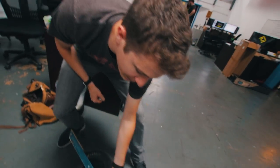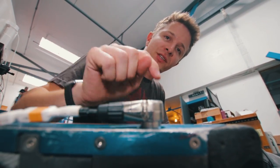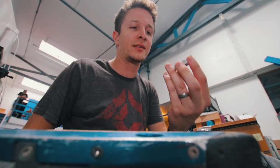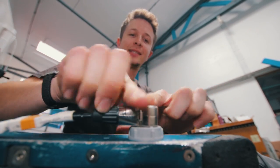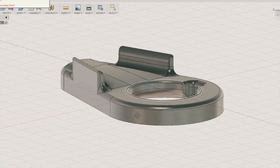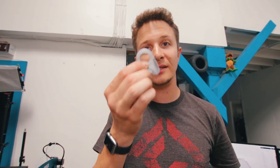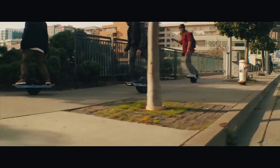Here is the finished plug — I've got a quick-release port so when I fall off it just unplugs and doesn't do any damage or get tangled up. Here's another problem I ran into: if I crash and it rolls onto its side, all the impact force goes straight into the plug, which isn't designed to take that kind of impact. What people do online is buy bushings and put them on to protect the plug during crashes. The problem is the bushing is far too large and doesn't get a good seat into the plug — it falls out easily, and the plug could break off inside, leaving the entire Onewheel dead. So I 3D modeled another part and 3D printed it today — this is the V1, this is the V2. I put it on, plug it in, and this should be able to take an impact without damaging anything.